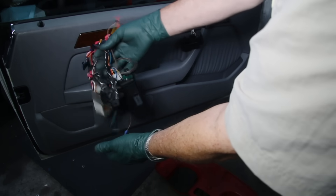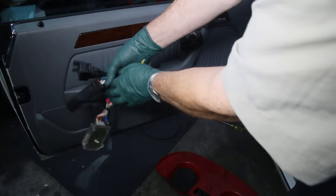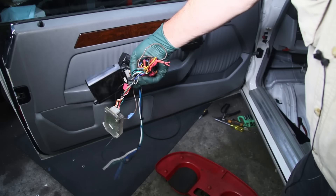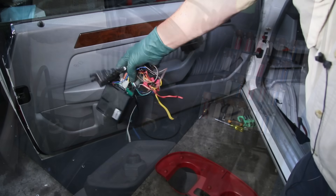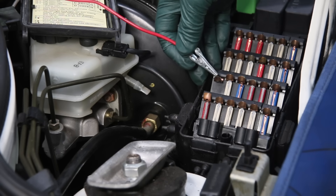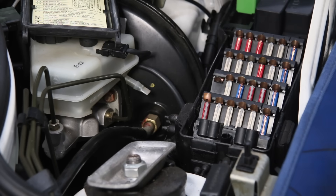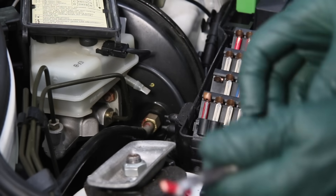Let's see what happens now, just with this cut out. Let's go back and do that headlight test and see if we still have a short on fuse C. The moment of reckoning has arrived. Touching this jumper from the headlight does not make that headlight come on. Now I'm safe to install this new fuse.